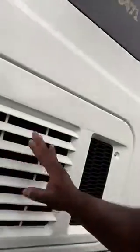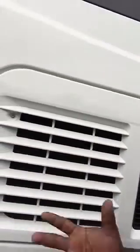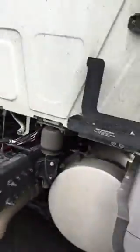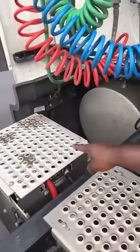Those units are made to be all inclusive in one. So if you were to pull up the tri-pack box that they have on a lot of these trucks, you would see that fan and that motor, but everything is inside of this side box already. So that over there is not your APU unit. If it doesn't have a tri-pack symbol or evolution symbol, it's not your APU unit. Everything is all in one inside the passenger side box, and that over there on the driver's side of the truck, it's right here, is nothing but a battery box.